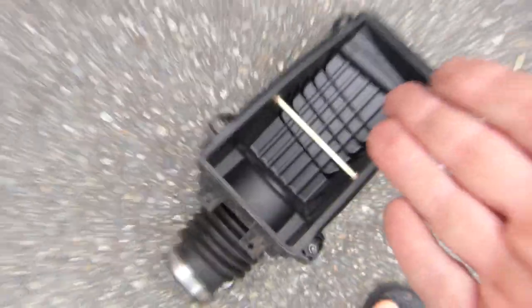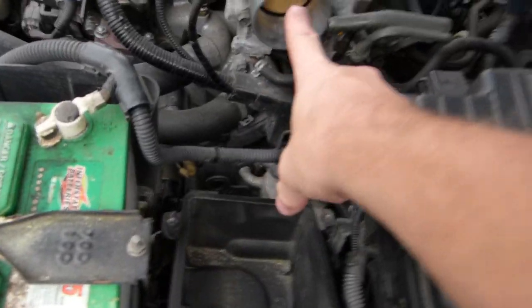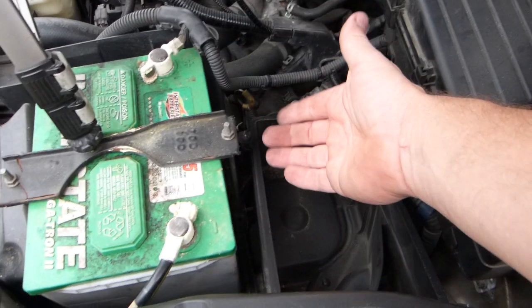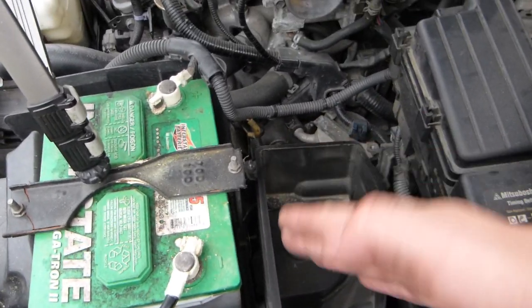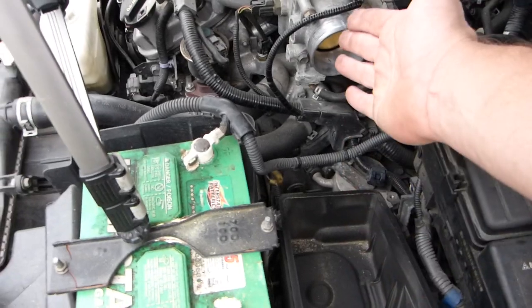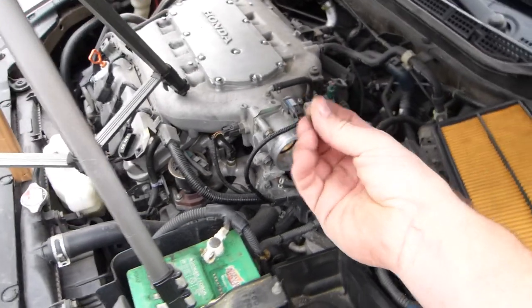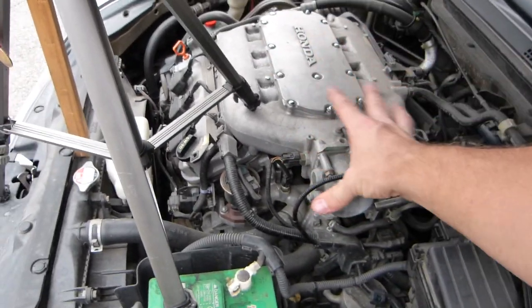All of the air that the engine takes in through the air intake ductwork, through the throttle body there, should be filtered. If there are any gaps in the seam here, unfiltered air is being sucked in with the rest of the filtered air, and all of that unfiltered air will be dirty air. Dirt, grit and solid particles will destroy the fine metal components in the engine, given enough time.